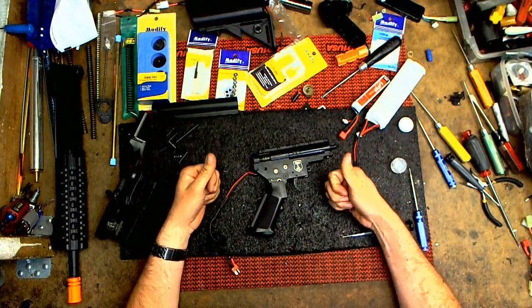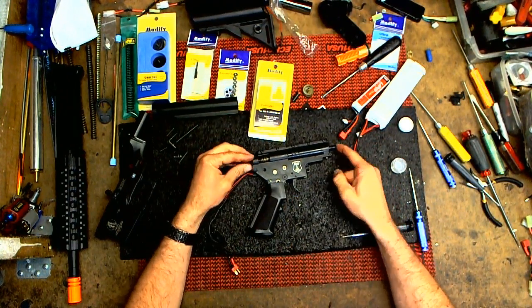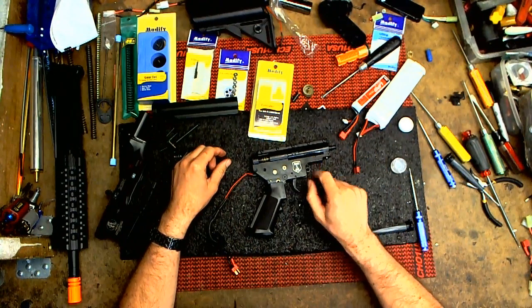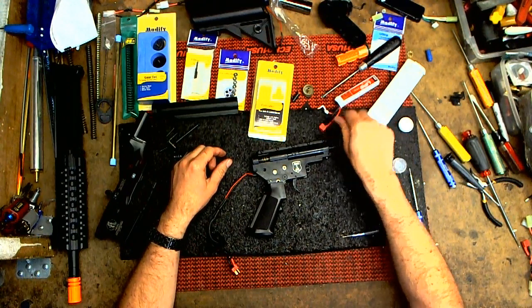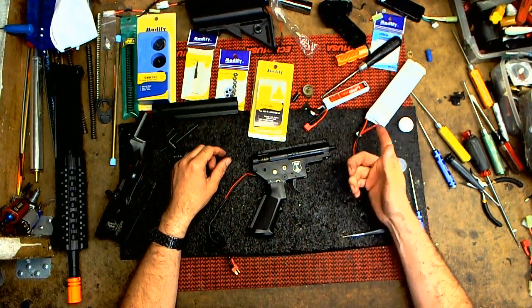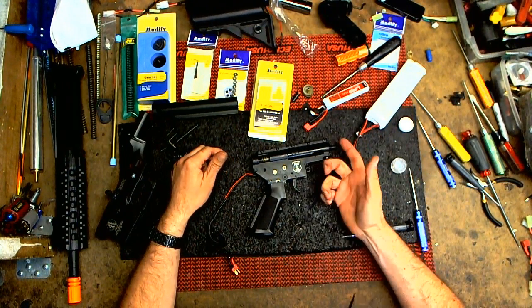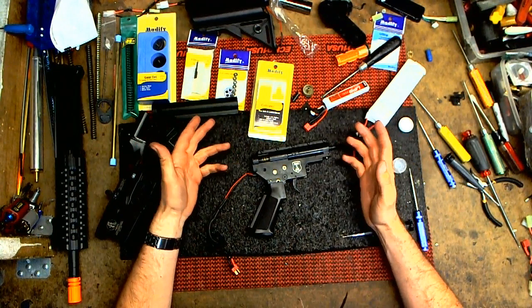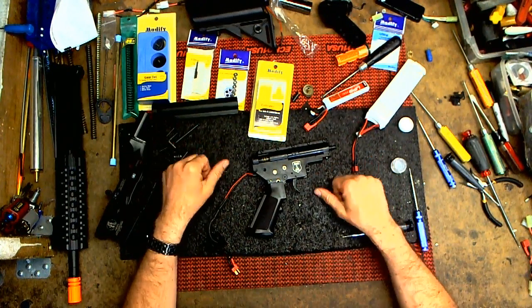Yeah. So I just dropped in the modified cylinder set, so it's a new air seal nozzle, cylinder head, cylinder, piston, and piston head, and ran it with the decent LiPo it's going to come with, and then also the big brick LiPo. It's like a 45C, 5000 milliamp, 11.1. Maybe that was like 200 rounds or so. So far, so good. And yeah.